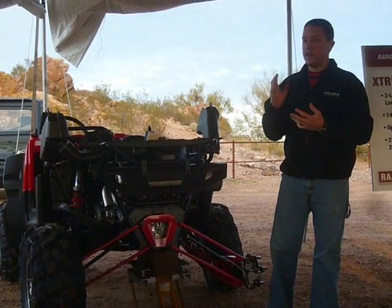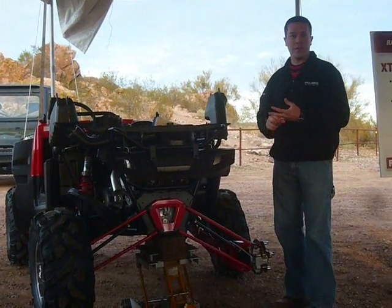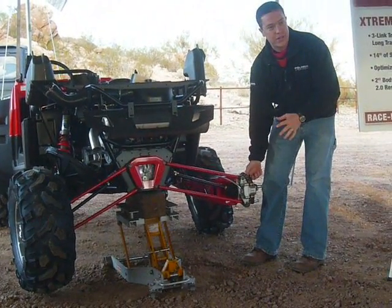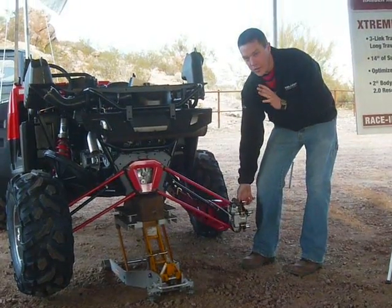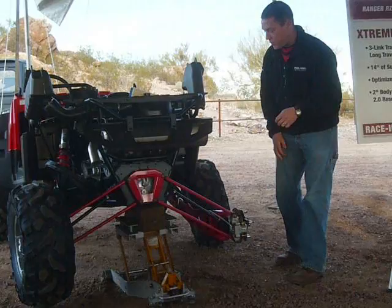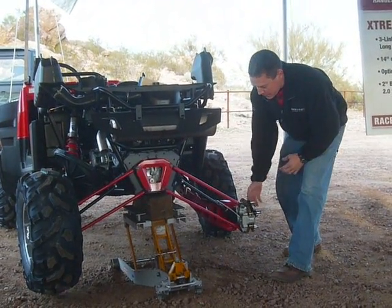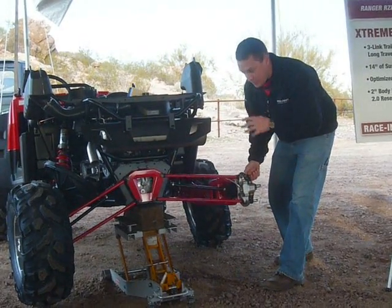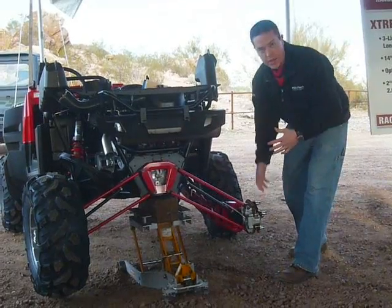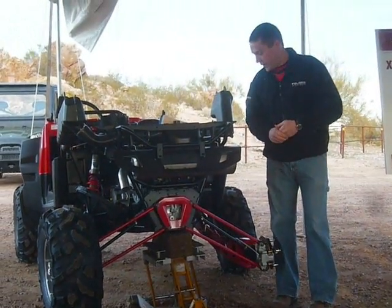If you're going through a straight line, everything soaks it up just fine. This thing is going to also corner on rails. So we help keep that tire on the ground, put the traction to the ground so you can come into the corners harder, go through the corners harder, and come out quicker. Now, a couple other things that we get: we already talked about the long radius rods, and we get a wider stance as we go through travel. That also helps get a slightly wider track width that'll improve stability even more yet.